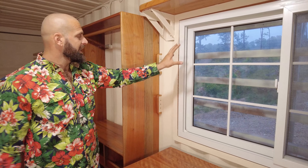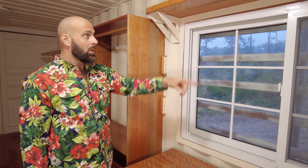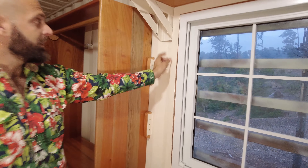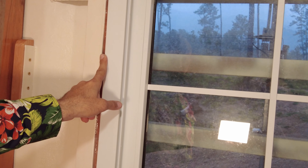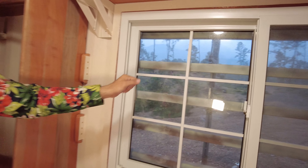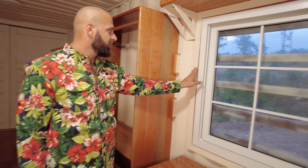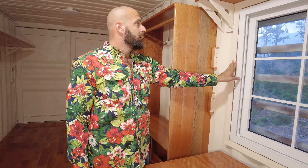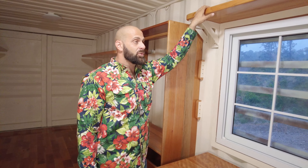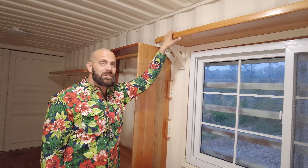What I did was cut a hole, calculate for the angle, weld the angle to the trailer, and then use a cedar wood insert. The window squeezed into a really tight fit, and I drilled it and put some screws in there for extra security, then siliconed the edges. There's another storage shelf up here of the same cedar, just for random stuff like a printer or other items.